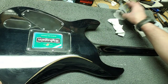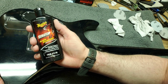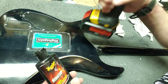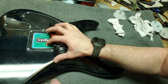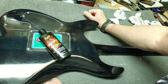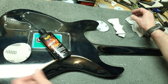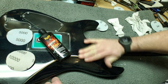Alright guys, if you ever want to remove some of your faint scratches, you can use this Meguiar's Scratch X. If you get the kit, it comes with the buffer pad. Just make sure you use a brushless drill — it's just easier and smoother. If you have really light scratches, you could do it by hand, and if anything you can use a 10,000 grit and a 5,000 grit — that way you just remove just the fine lines.